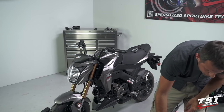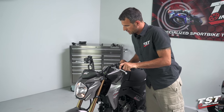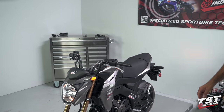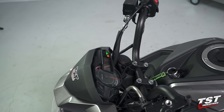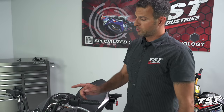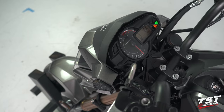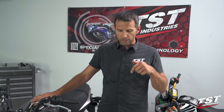We're going to power up the system and test it one more time. Blink it on the left, blink it on the right. Right now you still have one OEM signal on the bike, so the bike will retain the function of your dash indicator light. However, if you were to change both front and rear to LED type signals along with the use of this relay, you will lose that indicator function — your only indicator will be the front signals that you can clearly see from your riding position. This installation is complete and the bike's ready to go. If you guys have any comments, questions, or concerns, please place them below in the comment feed. Have fun, be safe — see you guys later.